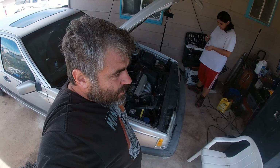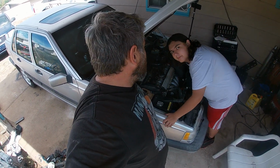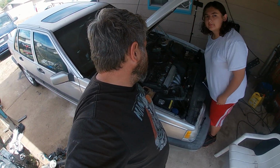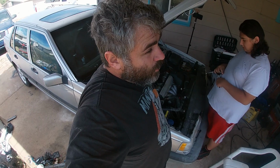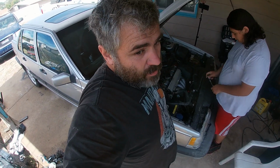This time, what me and Gogo are going to do is pull the thermostat housing and see if that might be part of it. Plus, the other reason that makes me think it's not the heater core, at least entirely, is that it's not super wet inside the car, anywhere. And we filled it up with water before we went on our drive.